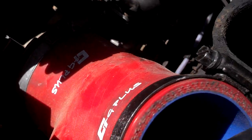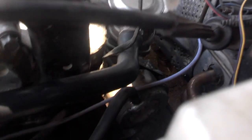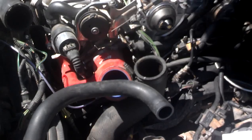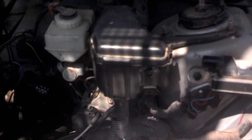That port on the bottom of your intake, under the one that goes to the base of that tube, goes around the engine back to the turbo. So this is the third hose that comes off the turbo, and if you look here where my finger is wiggling, that goes to your turbo bypass valve. So when your turbo bypasses, it blows air out of that valve and dumps it into your intake system. The cruise control has its own vacuum pump and hoses that go back into the firewall, so that's self-contained.